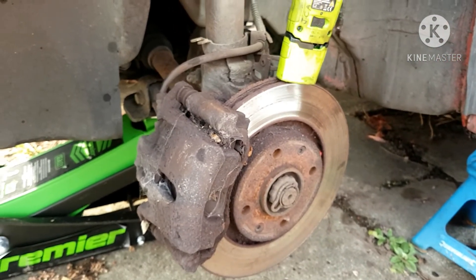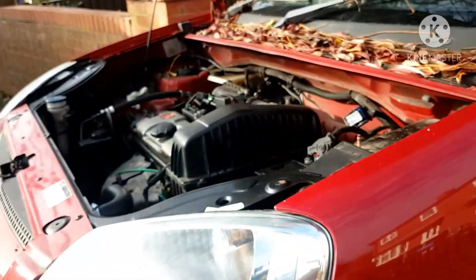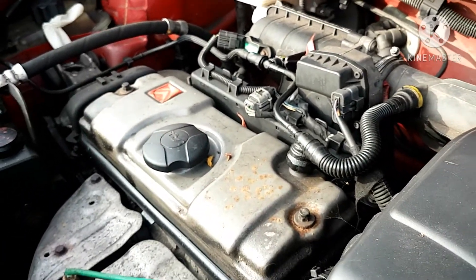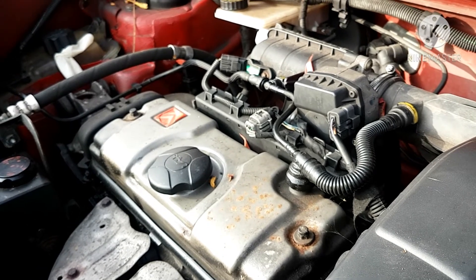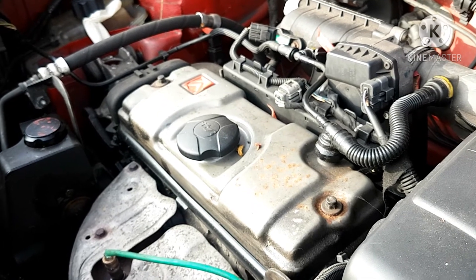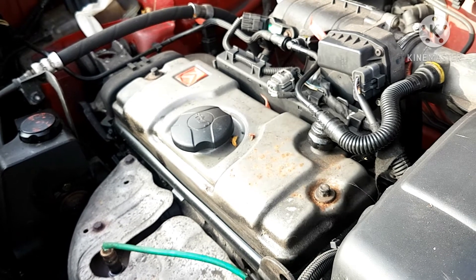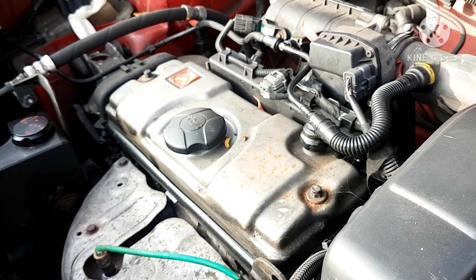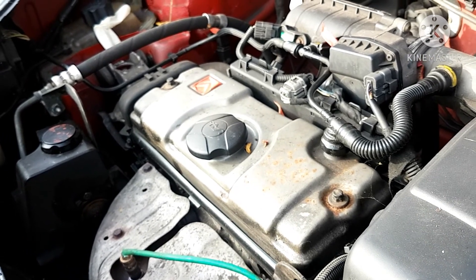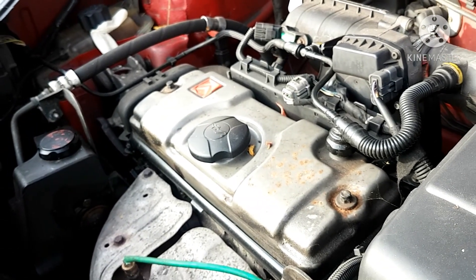So yeah, that should be good there. I'll make more videos of this — I'll probably see if I can rip into the engine. As I mentioned, the engine's going to knock. I already diagnosed it: the bottom end, the piston rings were actually scoring the sidewalls and it just ate itself up — had piston rattle and just gouged the cylinders up. Engine's done. We'll pull the head off and have a little look. The head and head gasket still seem to be fine, but the bottom end's gone. The vehicle just wasn't economical to replace and fix, so it was just better off to scrap it and move on. Thanks for watching.